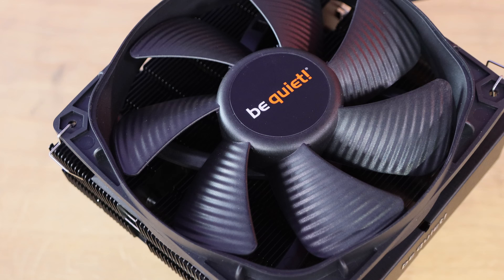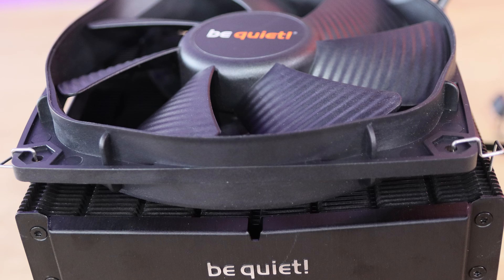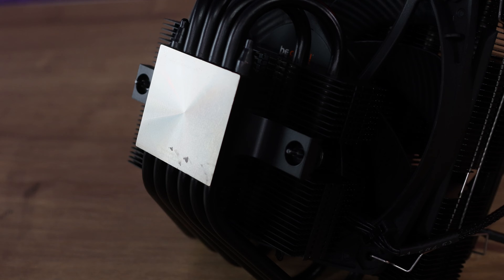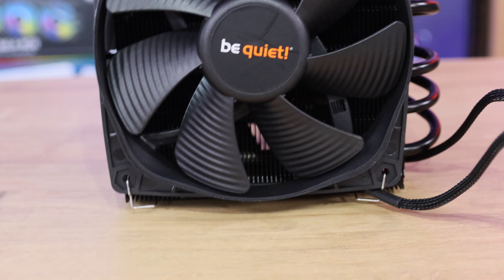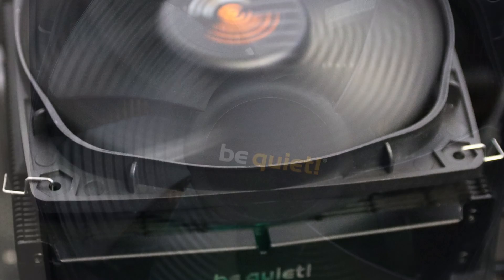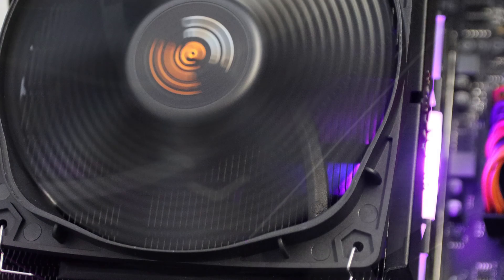Down to testing. With all our reviews we use the same machine where applicable — same specification, same updates, same programs, same drivers, and it's not connected to the internet. The full specifications are in the description below. Unlike many reviews, we set fan speeds at 50% and 100% to give a real idea of noise levels under normal operation versus flat out. Setting things to auto means the fan adjusts itself during tests, giving false results, so we set a specific speed to level the playing field between all tested devices.